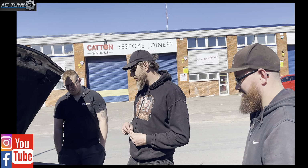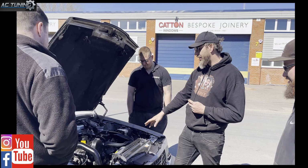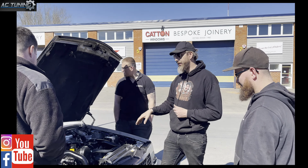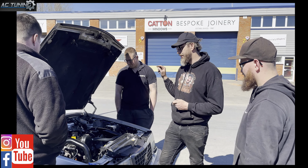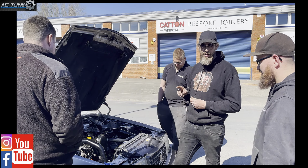Because, like you say, we've had other cars in the stable, as it were, that make this kind of power at this kind of boost level. And I'd be very interested to see what this slightly different turbo, slightly different cam setup does, where it does make the power, if it's going to be different, where it's going to change. I would say that it's going to make its power later. So I don't think you're going to get that 350 pound feet of torque at 3000 RPM.